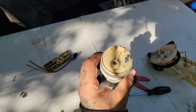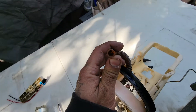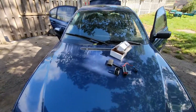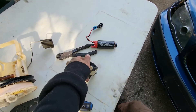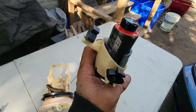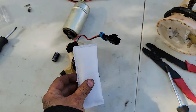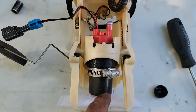That's super annoying - I just broke this fuel pump. This was the old one so it's fine, but the end broke off and was stuck in there. We're not running that anyways - it's still good to save it. If it's working, put it on the side and if you ever need another fuel pump later you don't have to spend money. Here's the 3D printed part - this just slides straight in here and clips into place, then the fuel pump goes inside of it. It's loose so you need a band clamp or hose clamp around the end. I got the hose clamp on it now - it's in place and doesn't move. Now we just got to put the filter on the bottom. Then we just hook up the pickup tube right here into that slot. You don't want to put your fuel pump too high - you want your pickup to be as low as possible right there on your filter.